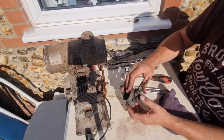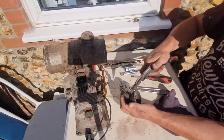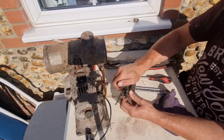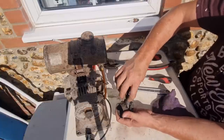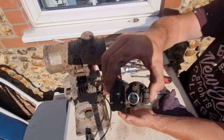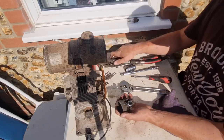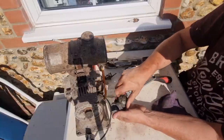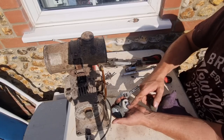Alright, there's a nut on the bottom, there's a tickle on that side. Let's give it all a blow off, then we'll get this carb stripped down. Take this plunger out - there you go, so there's a little plunger in there. That actually looks clean as a whistle, but there is a bit of crap in the bottom there. Can you see that? Bit of crap in the bottom. Alright, we are going to take the float bowl off because I'm curious as to what's in there. Oh my word - look at that white powdery stuff!